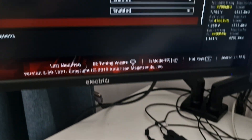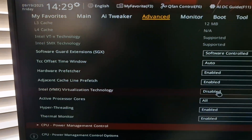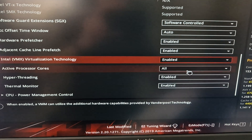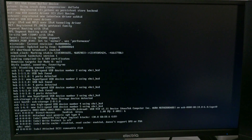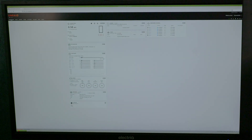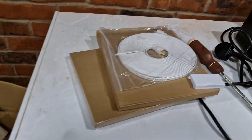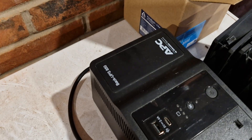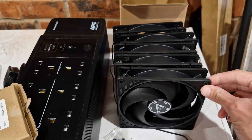I connected the computer up in my study and booted into the USB. In the BIOS there are some settings to tweak, like enabling virtualization. Once that was done, I booted into Unraid and it worked really, really well. Seeing the Unraid dashboard was a big sigh of relief. I then carried the heavy computer to my garage since the case is too big to store in this room. A delivery of more M2 screws and a fan arrived, so I screwed down the NVMe drive and set everything up. I also moved a UPS into the garage and had my new Unraid NAS running through it.